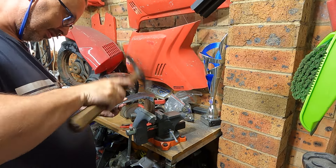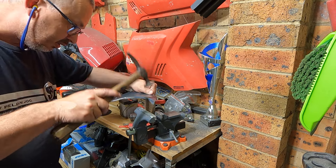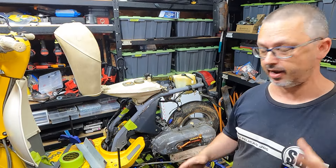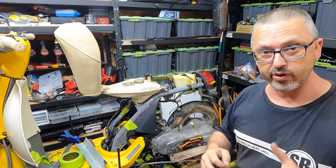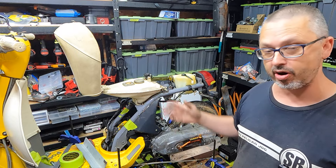Final adjustment — back over the dolly, smoothing out any little kinks and imperfections. These engine mounts are pretty much done. This is what it looks like underneath: very good, pretty much there. Still need to weld them up a little bit and add some bracing between the mounts inside the frame.